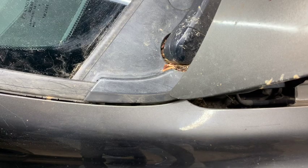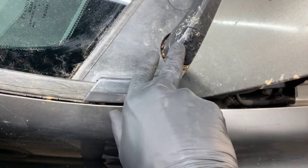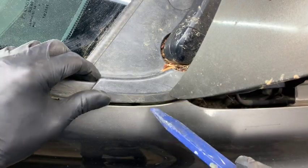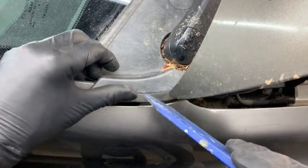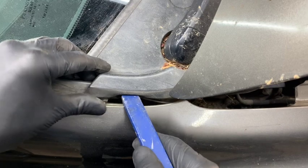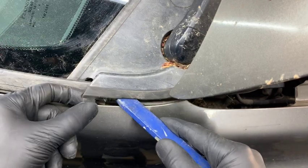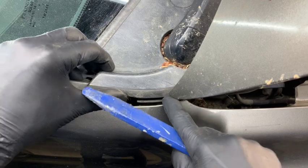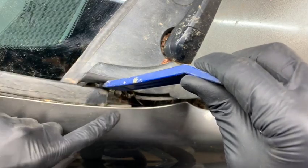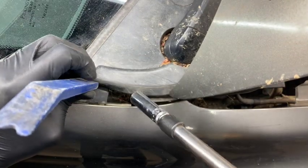Next, come to the top of the fender by the windshield and wiper arm. Pry back on this molding using a plastic pry tool — or a piece of wood. Be careful not to scratch your paint or mess up your molding. There's a little tab right here that loops underneath your fender, so push it down and then pull it back. Use the tool to hold it back, and you can see down in there is a bolt. Use a 10-millimeter socket to remove it.